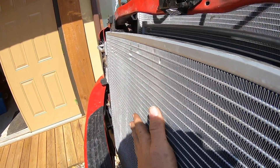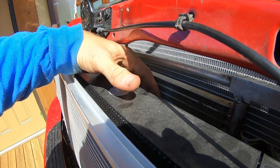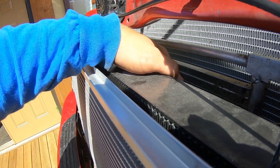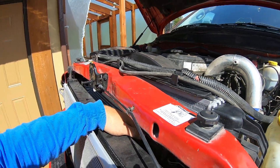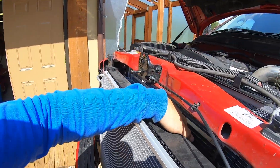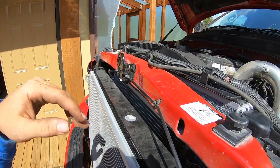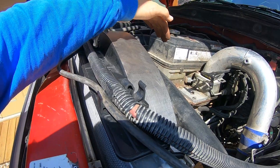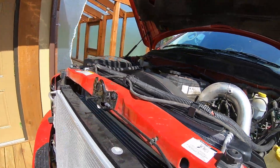I still can't feel air getting pulled through here, but I can definitely feel air getting pulled through here by the transmission cooler, which is exactly what I wanted. Going all the way around would be better, but this is good enough for now — we can do the other bit when we have more time. I'm happy to see air getting pulled through here at idle. Plus I don't have to worry about my hand getting caught in that fan, and hot air is only blowing out back here, not up here. That worked out really good.